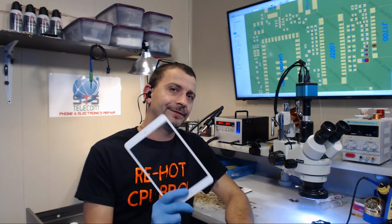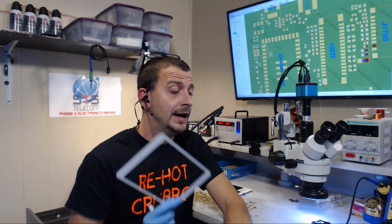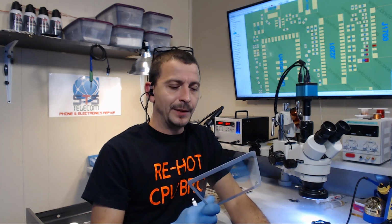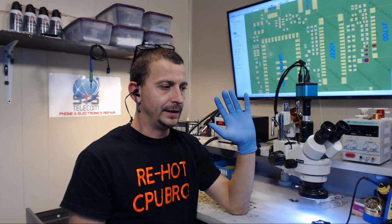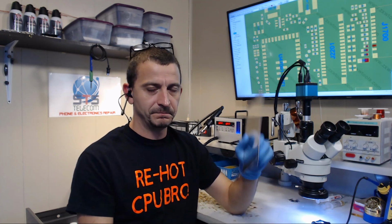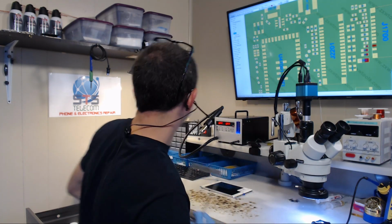And when I first started running into this, I had done 10 iPad minis, 15, I don't know how many I'd done. It'd been working out fine, and then all of a sudden, every one that I would do wouldn't work out, and I would want to drive a tool through the digitizer. In fact, I think I did drive a screwdriver through one of these screens, and I wound up finally learning to tape the bottom of it. I don't know if I just got lucky for the first 10 or 20 of them, but it got to where unless you taped that bottom, you had ghost touches. So here I am sidetracked.